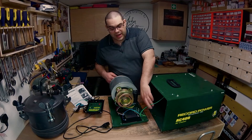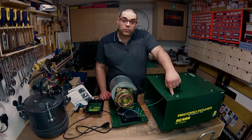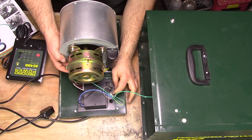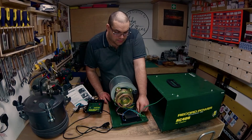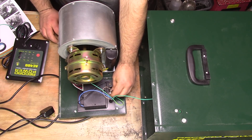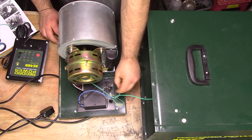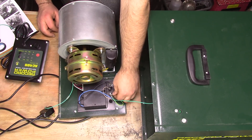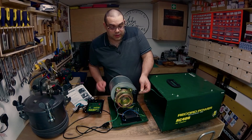Now there is an earth lead here that connects the two together, so we haven't got a lot of space to work with at the moment. We can either undo the screw here and remove the cable from that end, but we've also got one on the motor, or we can just unscrew it here where there is just a single bolt — and I'm going to do that. It's probably an 8mm, which it is. Just loosen that nut off and get the first one out — that's the one off the motor.